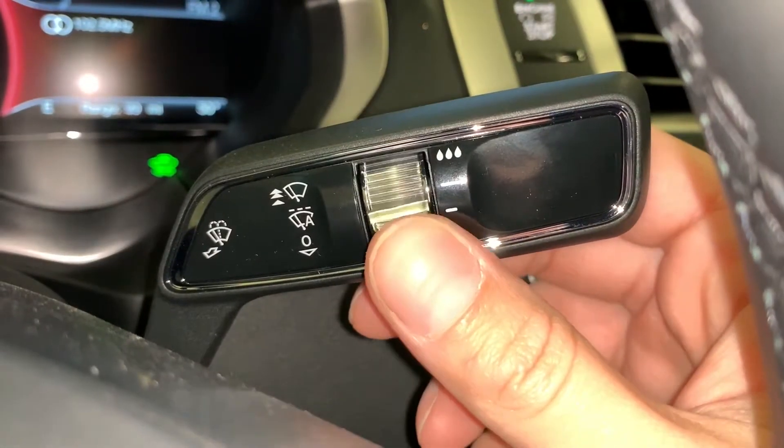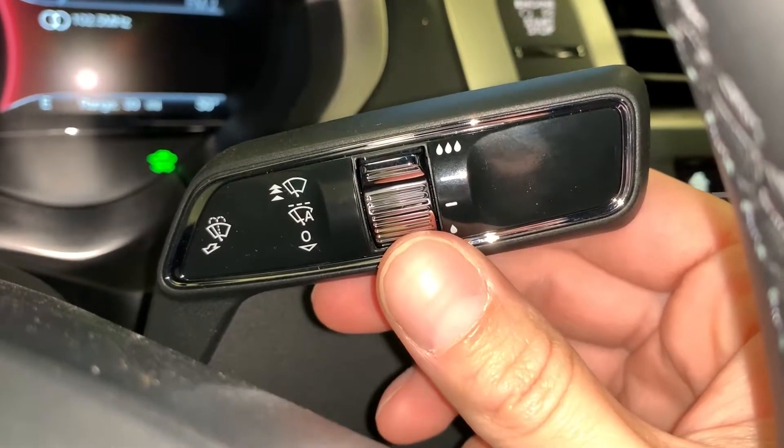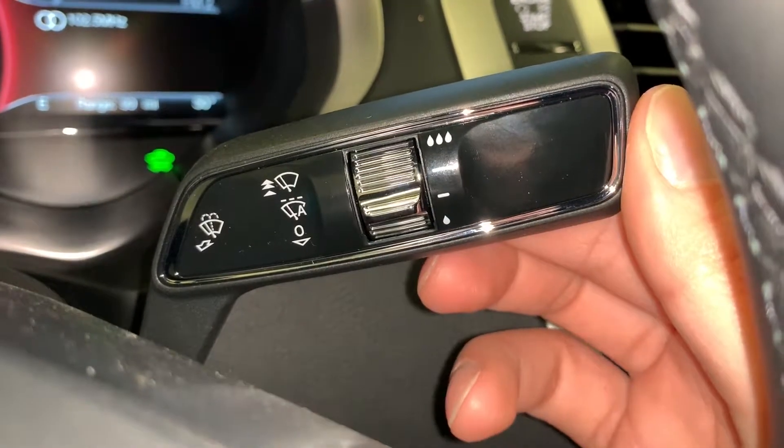This automatic setting actually has a few different modes. It's kind of like how you adjust the intermittent setting on your stock, but you're actually setting the sensitivity for the automatic wipes. So say if you had your setting on the lowest intermittent setting, that would be the least sensitivity — your automatic wipers are going to allow more rain to build up on the windshield before it wipes. If you were to turn the sensitivity up, that would have the rain sensing on high, and the rain sensing wipers would not allow as much rain to build up on the windshield.